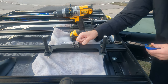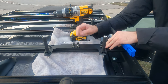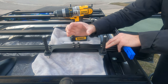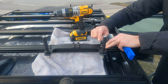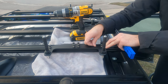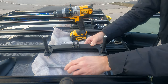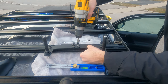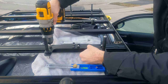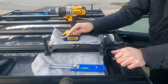After putting the Maxtrax on the truck, I realized these nuts — you can see here and here — the U has to face outwards, back towards the rear of the truck and the front of the truck. Otherwise they don't fit low enough for the locks to work. So again, I'm measuring four and a half inches from the outside, and I'll lock them back on. I've got an extra little tight in my hand just to be sure.